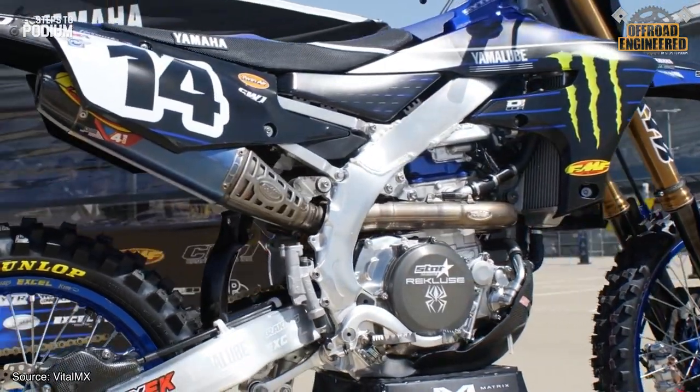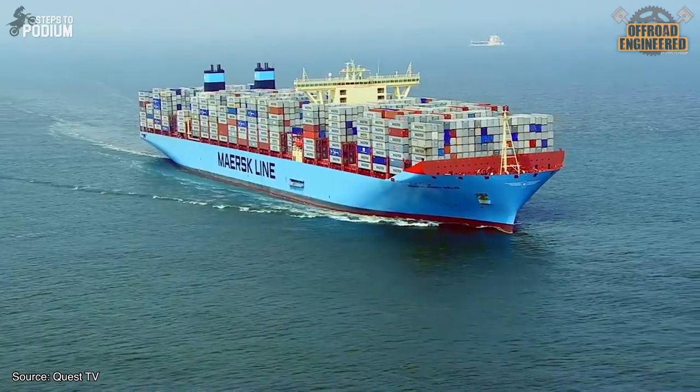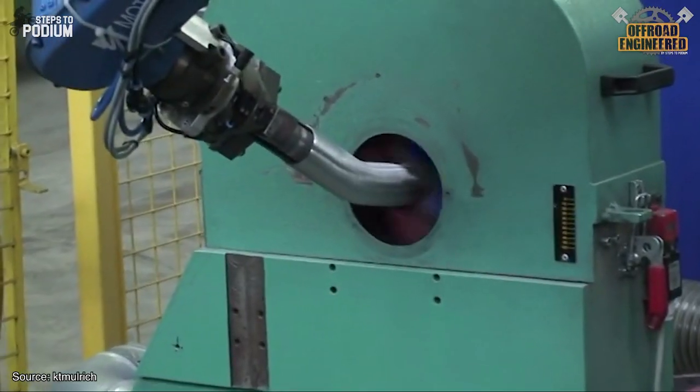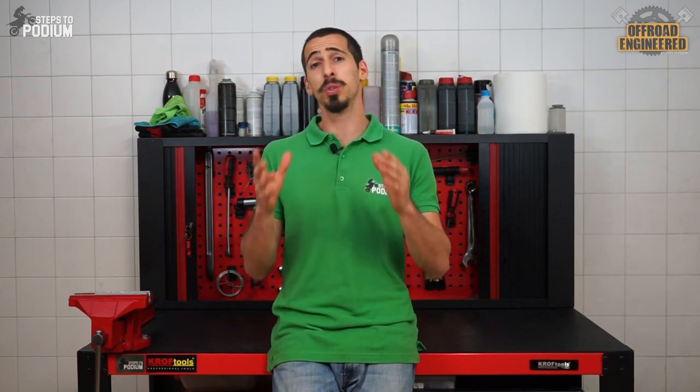That's why all Japanese manufacturers shifted to aluminium — they could reduce frame manufacturing time while also increasing quality control. The cherry on top: the hardening treatment of aluminium frames happens at ambient temperature while the bikes are being shipped across the world and requires no surface treatments. Steel frames, on the other hand, need time-consuming surface treatments before paint jobs and can also require heat treatments. A well-designed steel frame can be as stiff as an aluminium one, and in certain circumstances like off-road, nothing beats the spring-like behavior and forgiving nature of a steel frame.